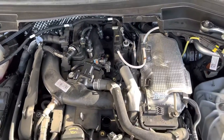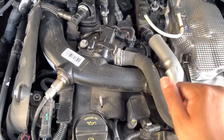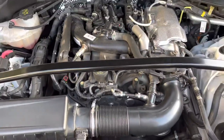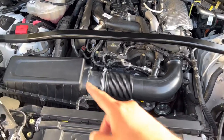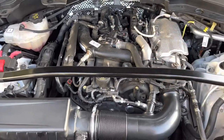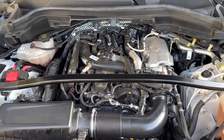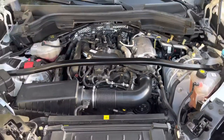Now I just have to put the clamps back, plug everything in, and start putting in the coil packs and clipping everything back. I'm done — coil packs in, one two three four, clipped back in, screwed back on, sensor back on, hose clamped. I did the spark plugs and the air filter. I currently have about 32,000 miles on my car — every 30,000 miles you've got to do the spark plugs, that's why I did this. Put the cover back on, press it down onto the nipple at the back, screw the two front screws, and you're done. Don't forget to like and subscribe — any comments or questions leave them below. Thanks, peace.